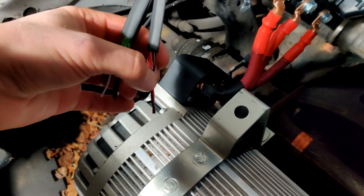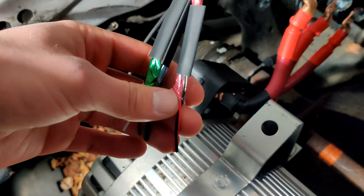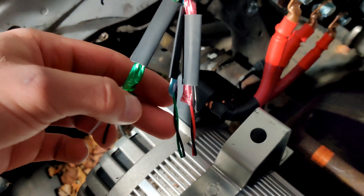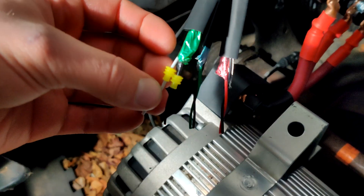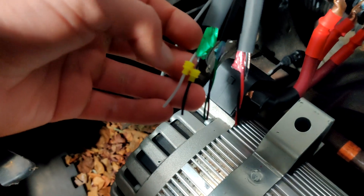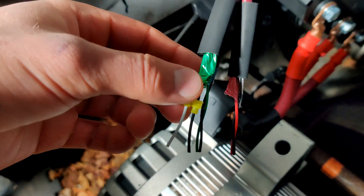Next you want to remove about an inch to an inch and a half of the foil and the plastic covering under it, and also cut back this small grounding wire about an inch and a half from the end. Once you do that for all three twisted pairs, go ahead and put these little rubber AmpSeal waterproofing connectors on each one of the wires. Make sure the narrower end points towards the end of the wire and the wider end towards the connection to the inverter.